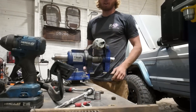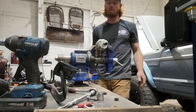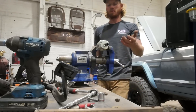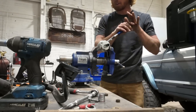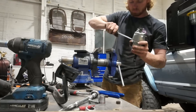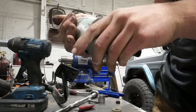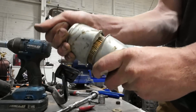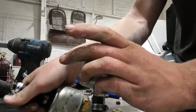I've got the fuel filter in my vise. I'm going to pry it apart just because I'm curious — I want to see how much it was stopping. If one side is clean and the other side is dirty, I know it's just a clogged filter. But if both sides are dirty, I know I probably have other issues. And... it's just a clogged filter.